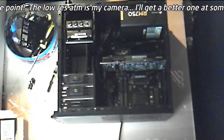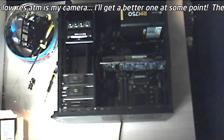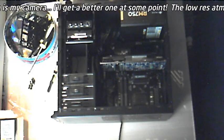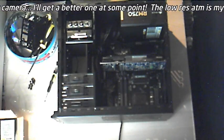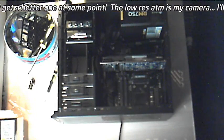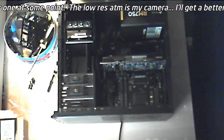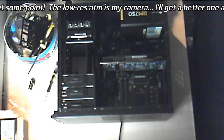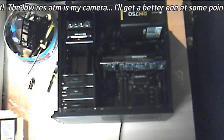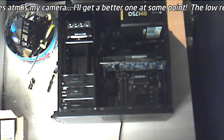Okay, let's grab one of the two. In fact, no, let's grab both of them and then I can manage them in, get them to look nice and tidy. That's a Molex adapter, so I don't need that yet. I do, however, need my 8 and 6 pin connectors, which I have here. I'm just checking them, because I'm going to do this in such a way that they're all somewhat tidy. I'm going to need my other card so that I can actually get a base for where that's going to go. So please hold while I go grab that.